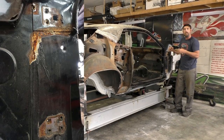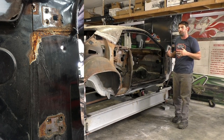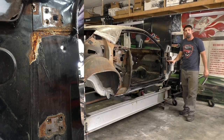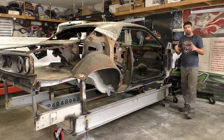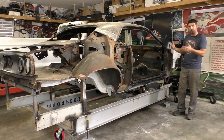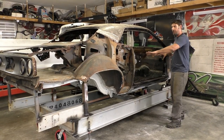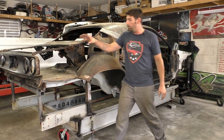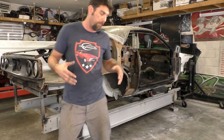A lot of times under the drip rails and where the seam sealer is, they put the seam sealer on and it's rusting underneath it. So a lot of these survivor cars - unless you really strip them down, there's a lot of rust showing up. That's what we talked about with the owner as we started looking at this car. Even though it had a lot of work to it, we're going to sandblast some of it and also remove the rest of the trunk area on this e-body car.